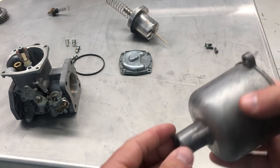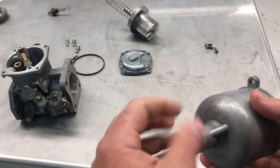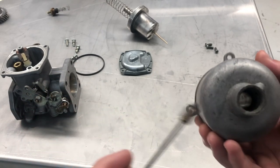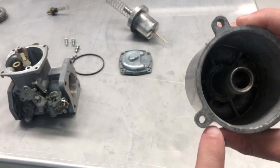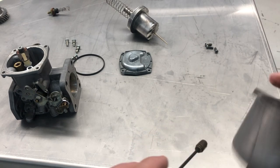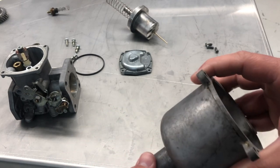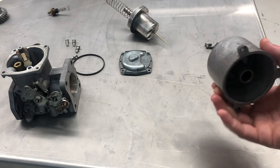With a polishing abrasive, which is what we're using tonight, we're not going to do that. I wanted to show you what this part looks like before. This part's been cleaned to some extent already, but you can see all the old gasoline and varnish buildup in here. I'm going to shoot down the bore, clean the brass piece, and clean the plastic up — it's not going to damage the threads. This is going to be completely safe and clean after we're done. We're going to be using the VH-1000 to clean this thing up, so let's get started.